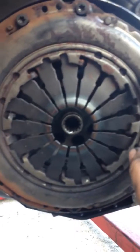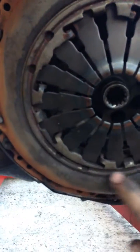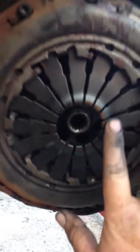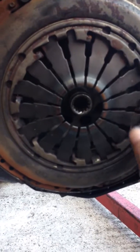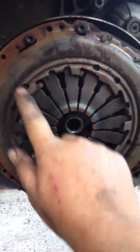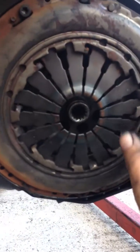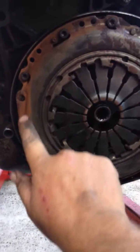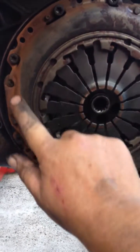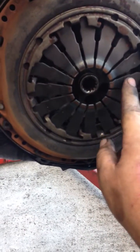The other engine had a knackered clutch. What I've done, I've actually got a clutch here - it may look used but I've checked the tolerances on these clutches and they're well within tolerance. So I ain't going to pay out on a new clutch - there's plenty of wear, this hasn't been in that long. I can tell by the wear of it. I think they put a clutch in and then realised there was a problem with the engine. The little bit of rust is where it's been just sitting. I know people say when you've got the engine apart you should put a new clutch in, but no - they're still plenty of life on that. That's going back in. I'm not going to pay out £200 for a clutch when I don't need to - that is fine and I'll guarantee that will work.